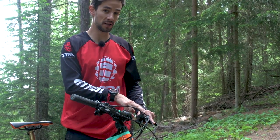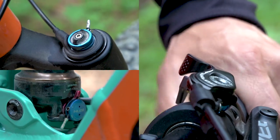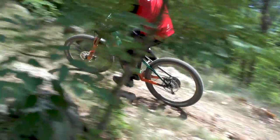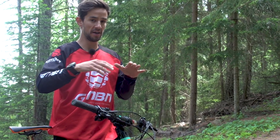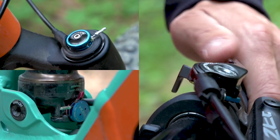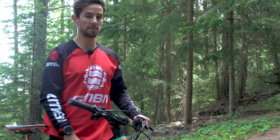You've also got the Scott Twinlock system. At the moment it's in fully open, so 150mm travel. Go halfway and that's 110mm — they call that Traction mode. That's really good: it keeps your BB higher, great for pedaling these bikes uphill, keeping that bottom bracket higher. It also firms up that suspension and changes the spring curve. Then all the way to full lockout for really smooth fire roads or roads, for maximum efficient pedaling.